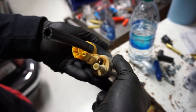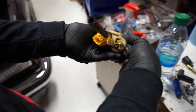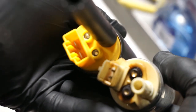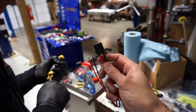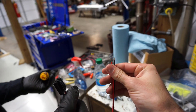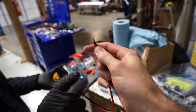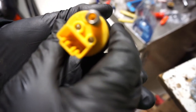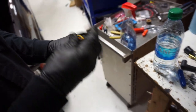Body of them, it looks like the body's bigger. Wiring harness is going to change, but they do give you a harness. So you can see the difference right there in the pigtails. Obviously, you're going to have to change it, but that's okay because we have this. And that's going to go right into place of that little connector. And it looks like we'll have to probably have the rest of the sending unit out to hook this in, potentially. So we may have to disconnect those wires at the top. But other than that, it is apples for apples.